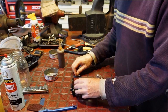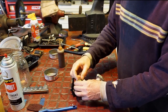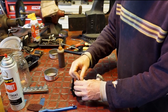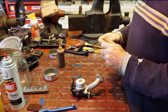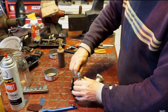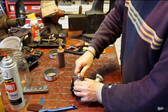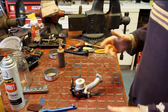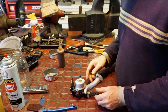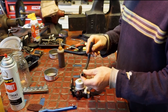Just going to do a quick blow test — a cursory check. This all looks very good. These are nice engines. I know some people don't like them, but I like them because they come off the rusty machines and the bolts don't break, unlike Briggs. These carburetors sit a little low so they tend to get gummed up, but so does every carburetor. They have nice primers on them.